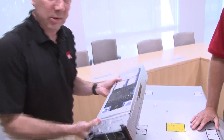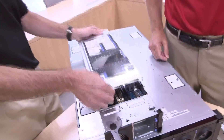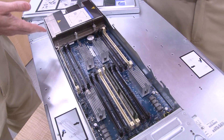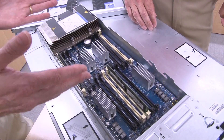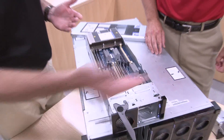Each compute book has one processor and a total of 24 DIMMs — 12 DIMMs on each side. On this side of the compute book we have the processor: this is the Intel Xeon E7 V4 processor, the latest processor, with a pretty significant heat sink on top to keep the processor cool. The server supports the E7 4800 and 8800 series processors. These are the Lenovo True DDR4 memory DIMMs — 12 DIMM sockets on this side, 12 on the other side, for a total of 24. With the four compute books installed, that's a total of 96 memory DIMMs — a really significant memory capacity.